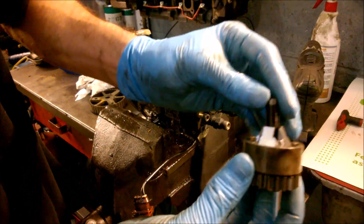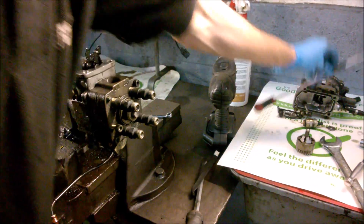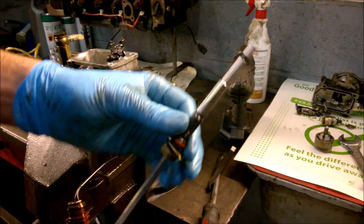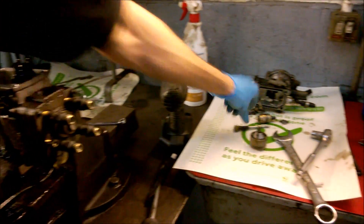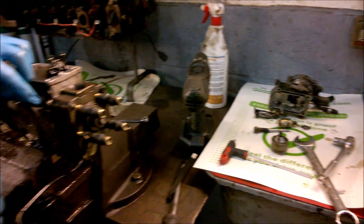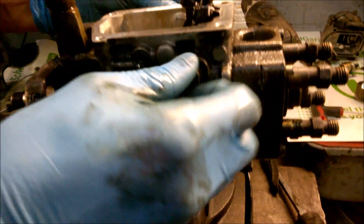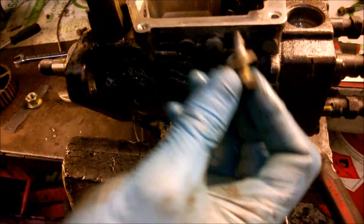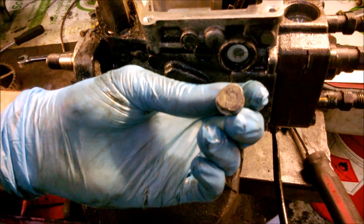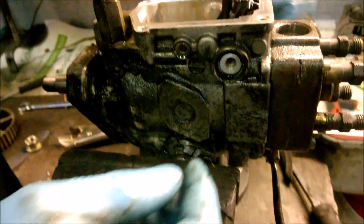I've tipped the top bits off. The assembly weights, governor assembly — and then you've got the bit that goes through the centre there. Make sure you don't lose that washer; if not, you're just screwed basically. And then you've got two funny 13mm bolts — if you come down to here on the side. They've got a funny head on them and you need to modify a 13mm socket to fit them, but there's one on each side.